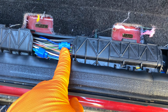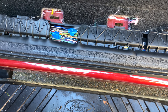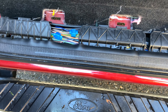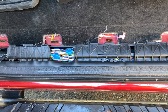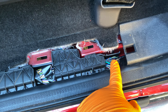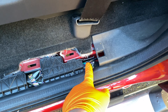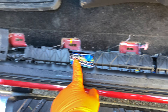Vampire clamps, vampire crimps, whatever these things are called — I think they don't hold up over time, they can damage the conductor inside the wire and lead to problems down the road. A while back I had wired in a circuit for the tailgate actuator, and I did a solder connection. So since this is already at the tailgate, I'm just going to eliminate this wiring here and pull it out.